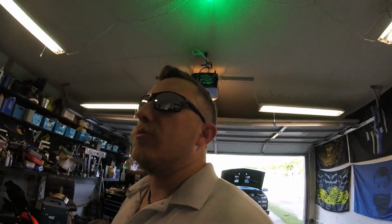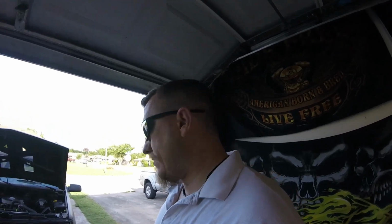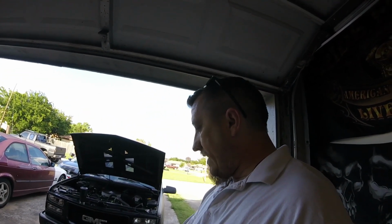And it was working fine until I turned the AC on. Then when I turned the AC on, it popped the belt right off. I lost power steering. I lost everything. So then I went back and got a different number belt. I thought, well, maybe we'll try a different number. That one did the same thing. So this time we're going to try 40, 60, 957, and then I got a new tensioner. Maybe that's the problem. But that one seems pretty tight, so anyway, we're going to try it.